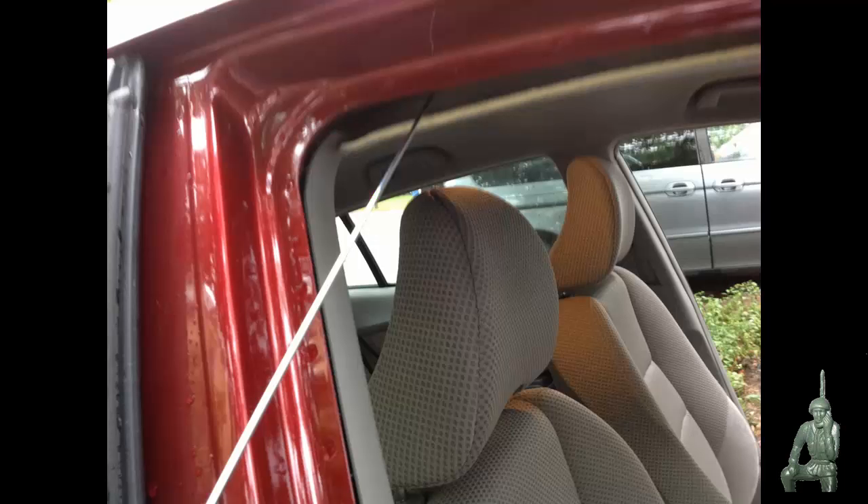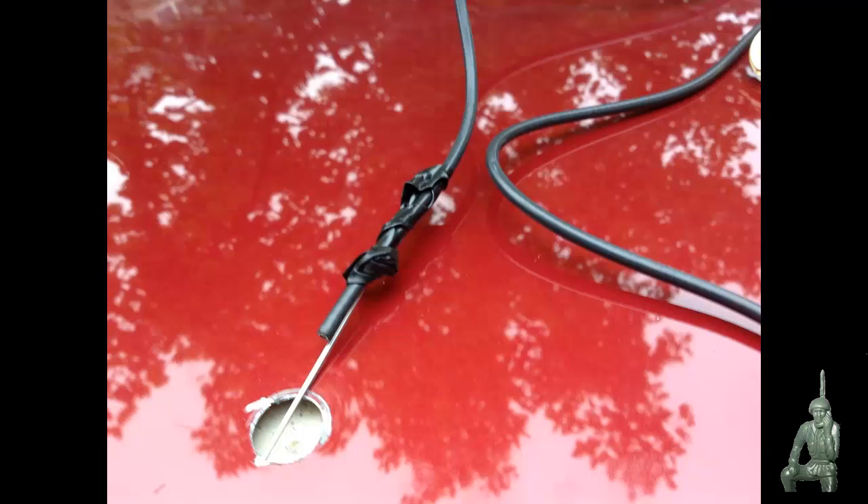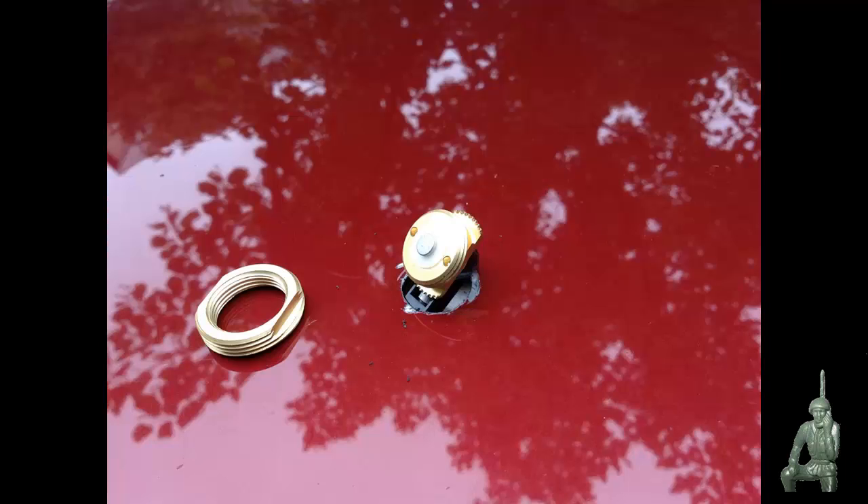I have an old antenna that I use as a fish. I pulled the molding down around the door jamb, gently pulled down the headliner so I could slip the antenna above it, and worked it towards the hole. I pulled the antenna out through the hole, used a little electrical tape to tape it around the coax, and gently pulled the coax back to the NMO mount. At the hole, you cock it on an angle and it will pop down into the hole — this is the only way to get it in there, since the center part of the NMO connector is larger than three-quarters and won't fit up from the bottom.